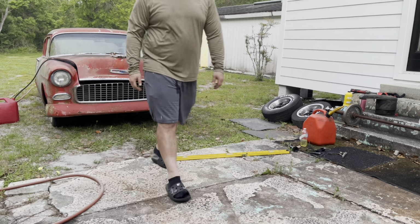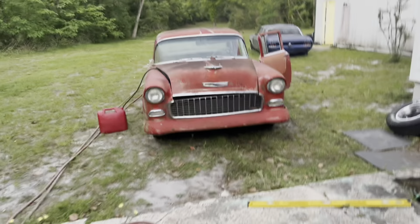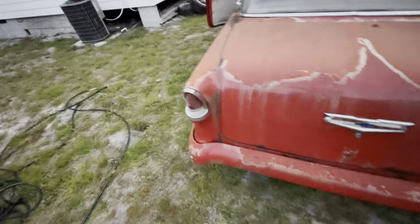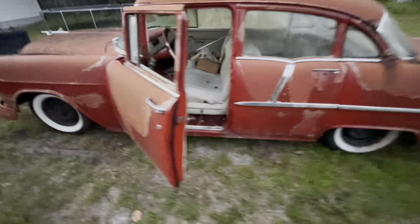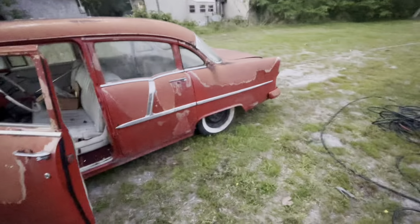Well, brakes work. Yeah, I mean, somewhat. All right, so the brakes work enough, anyways. It's still only pulling from the can. It won't pull from the tank. I don't know if there's like a split in the line somewhere and it's sucking air or what's going on, but it's still running good off of that gas can, not off the gas tank.